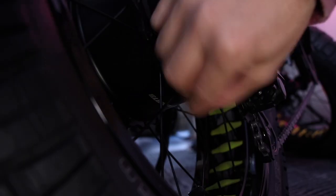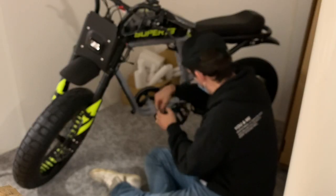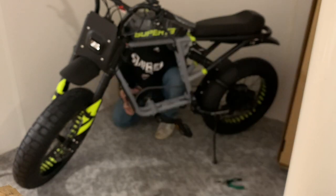Third tip: just check everything around the bike near the speed — check if there is a cable that is too long and might be banging against the spoke of the wheel. If that happens, don't use your bike at extreme speed, and as soon as you can just cut the cable a little bit shorter. Final tip: the left pedal is screwed counterclockwise and the right pedal is screwed clockwise.